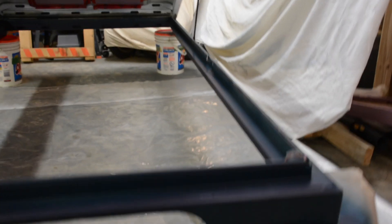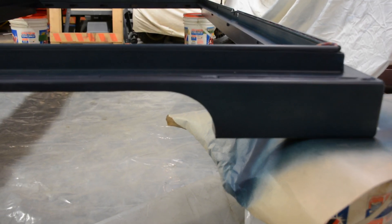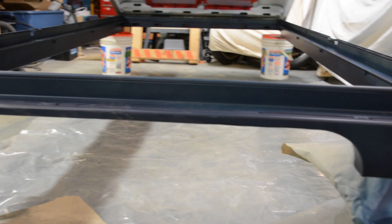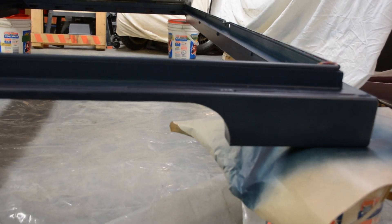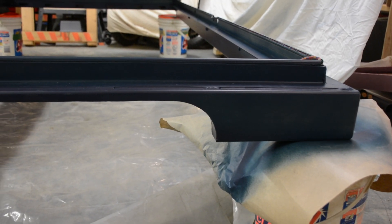The reason why the lower frame has to be that tall is because of the way the back door is constructed on the Land Rover Defender — it goes inside the roof, so we have to accommodate for the door going into the roof. The first step was to take one beam of 4 by 2 and cut it open to remove space for the door. I kept that cut-out piece and welded it back up on the upper frame to close the opening you can see on the roof.